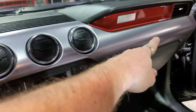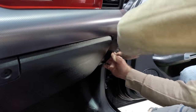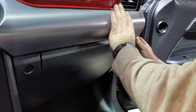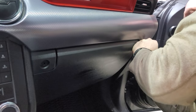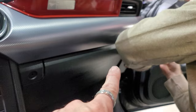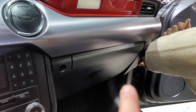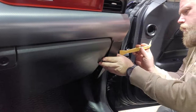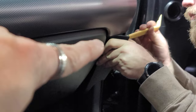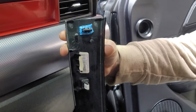To remove this radio from the factory we're going to start with pulling this piece off right here. We have to remove this whole entire long piece, so we take this off first because there are two screws here and then the rest will all pop out. Use a plastic pry tool — it is plastic and it's just got plastic clips in it, so you want to be careful. The reason it's getting caught up is because of the way the clips are set up and there's tape holding it. See where those clips are — that's why it's a pain to get off.